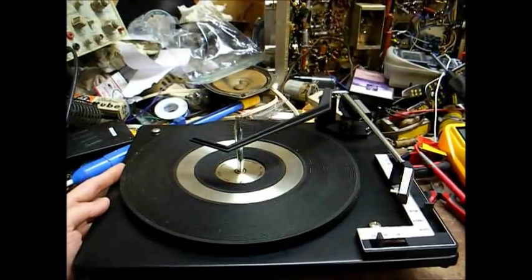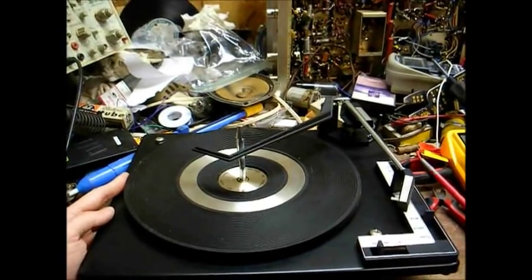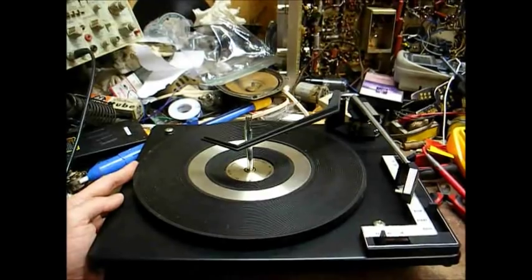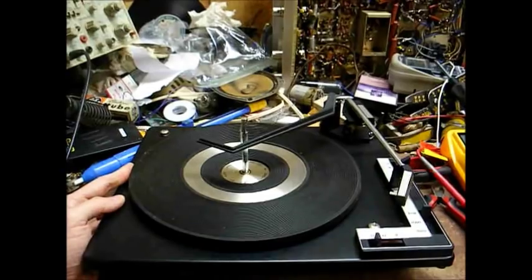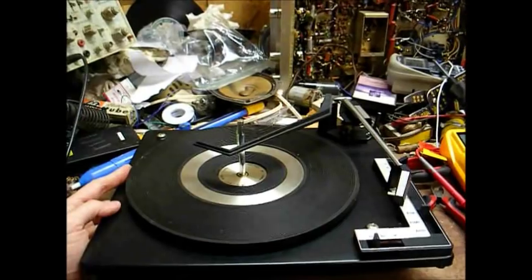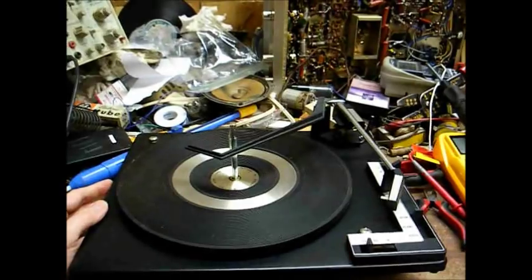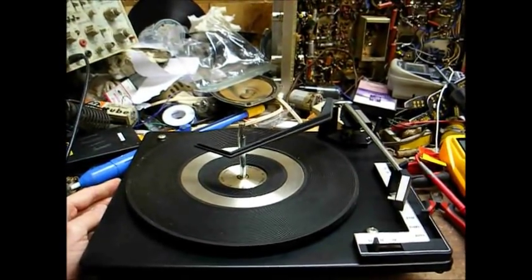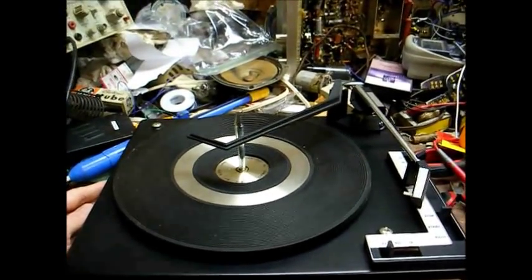In fact, I was seeing this problem 25 years ago. Now we're going to look at steps to take to free it up without damaging the record changer. So many of these I get, after they become frozen, people will try to forcefully turn these and it ends up ruining the mechanism. The key is you want to be gentle. Take your time. Once these BSR changers are cleaned and lubricated, they're usually fairly reliable for their intended purpose.